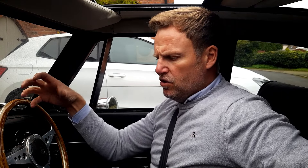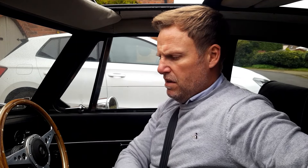That's it. Glad I did that — I think I need to tune it still more and spend more time with the curves, but I'm taking all this apart anyway for the supercharger, so it'll all get done on the rolling road. What I've done by moving the distributor physically is given myself more flexibility, because the 50-degree limit in the distributor was really restricting how far advanced I could go. That's something people should be aware of if they're fitting one of these — it might need to be a mix of mechanical advance set at the distributor and then tuning inside the app. In my case I couldn't just do it all in the app. Thanks for watching — like and subscribe if you want to learn more about the supercharger project. Until next time, my name is Craig and I'm exhausted!